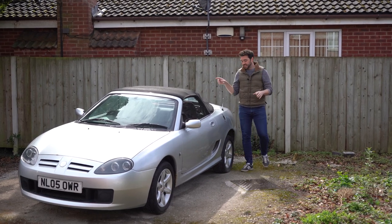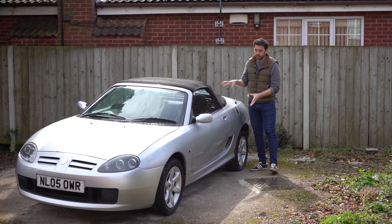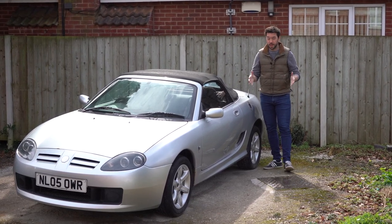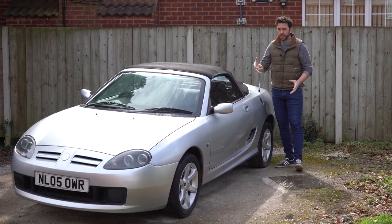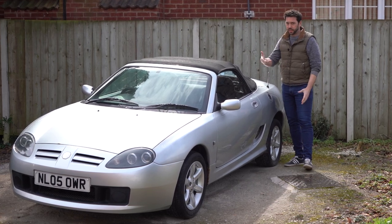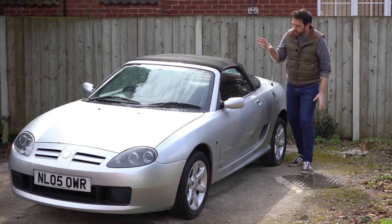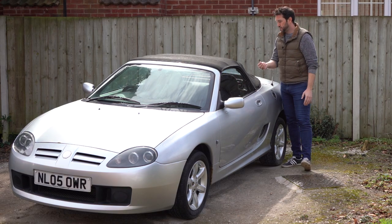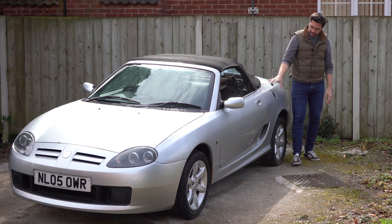The fuel in this car is at least 14 months old - I've never taken it out and never even run the car. Over time petrol can become stale and go off, and I don't really want to run that through the system. It's going to struggle to start, and even if it did start I could be blocking things up. The fuel tank sits behind the driver's and passenger seat and I don't think there's a drain plug, so I'm going to try and siphon it out.